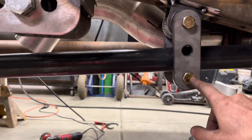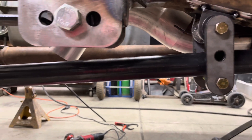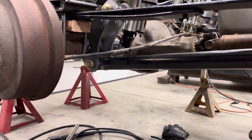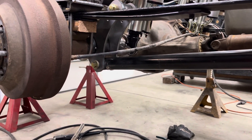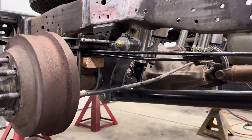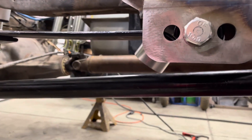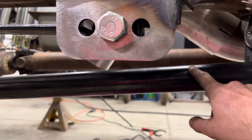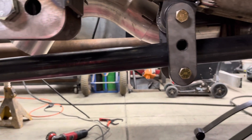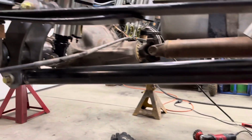It's just sitting on this bolt that helped me hold it up and get it centered under the hanger. I went ahead and did a simple chop saw notch on that end, put it up against the bushing, and just tacked it into place. Now I'll get the top one — one and three quarter, 250 wall — and get it to land somewhere in here. Once I start cycling the suspension I'll figure out the total length, chop it off, and put that end on.